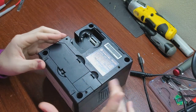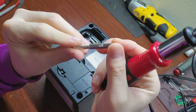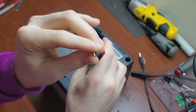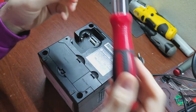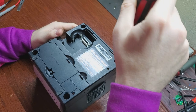Making sure there's no bugs in there, you'll need one of these little game bits — you can grab them off eBay, Amazon, or AliExpress. This one is 4.5 millimeter and has a little star-shaped tip. You just take off all four screws on the bottom and then the top will lift right off.